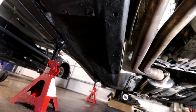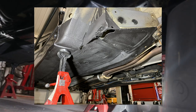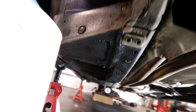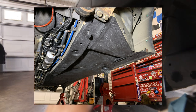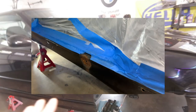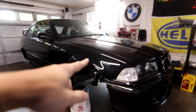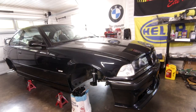Another exciting thing that you may have seen on my Instagram is that I spent about a month completely masking the entire car and fixing any and all of the rust that I could find, and we did a nice undercoating on the entire bottom of the car. You're not going to be able to see it, so we'll try to find some pictures to include here. But I also pulled both of the side skirts off and we sanded and fixed a ton of rust, as well as this entire fender, which had so much rust along the inside that I cleared up the best that I could. There's a nice coat of black undercoating paint on there now, so that's pretty well dialed in.